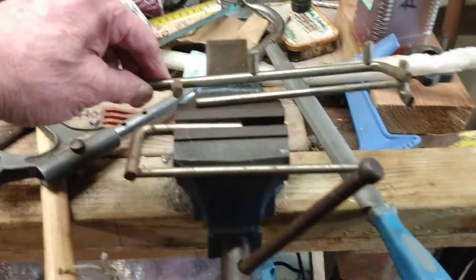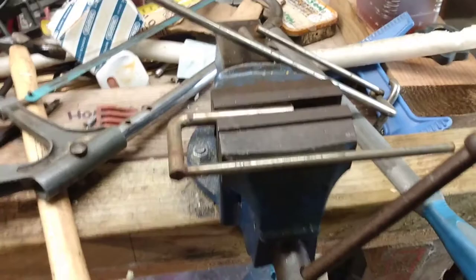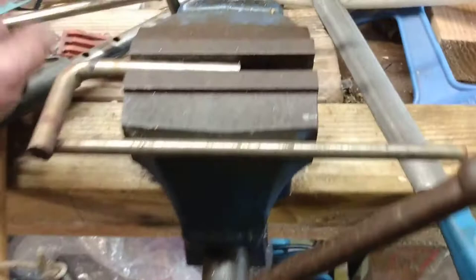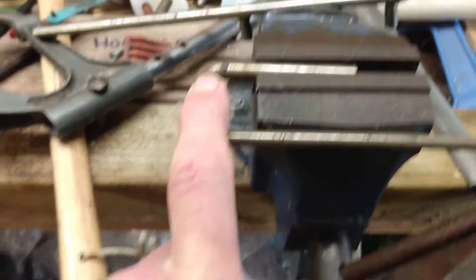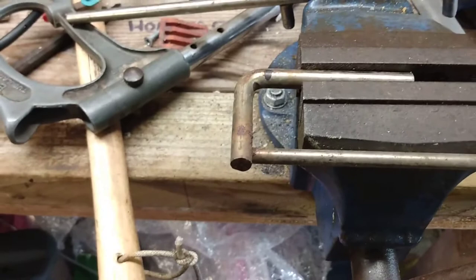My plan is to take a piece of bar stock steel. This has come off an old commercial oven tray — heavier than a regular oven tray. The bar stock is from that. The piece I'm cutting now is a little oversized, because I want to be able to drill into it, insert part of the skewer, slot it down, and then weld. I'm not sufficiently confident in my welding to just drill in and weld around.